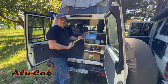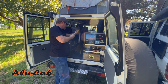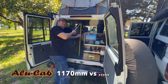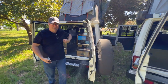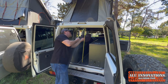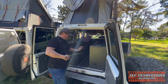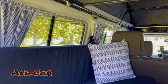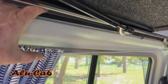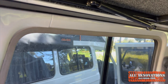The last measurement: from the standard floor to the underside of the roof, the Hercules measures 1170mm — that's your clearance. The Kronos with Sean's added floor comes to approximately 1120–1130mm, so call it about 40mm difference. Sean and I are trying to understand where that level change came in. Looking at the Hercules, the distance above the window — and comparing with the Kronos — shows that the Kronos has been dropped a little bit more inside to account for that 40mm difference.